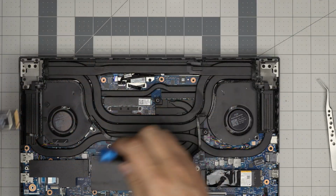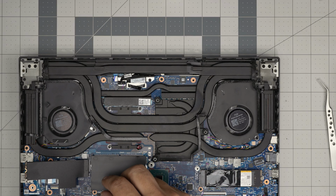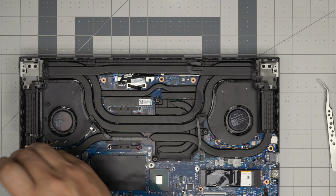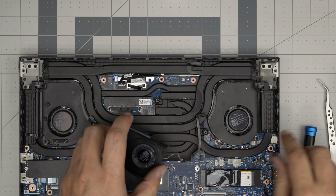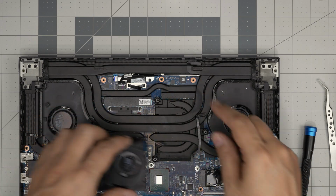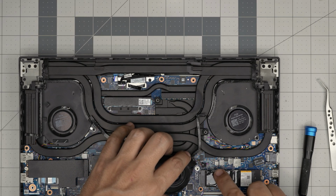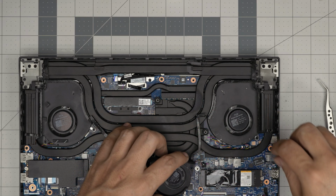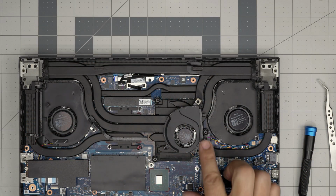All right, grab the SSD that you removed, put it in at a 45-degree angle. Bring it down, make sure it's aligned with the screw hole, and put the tiny screw at the back. Grab the fan for the rest of the components that cool it down. Where the fan connector was, right there. Put the fan connector in place. There we go. Put it in an offset position.